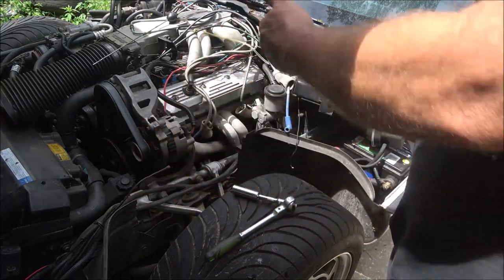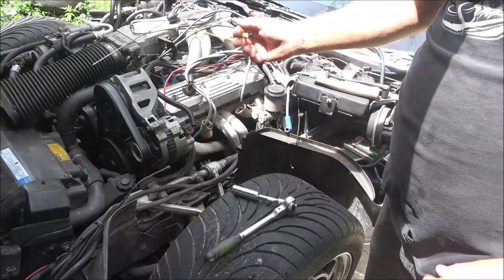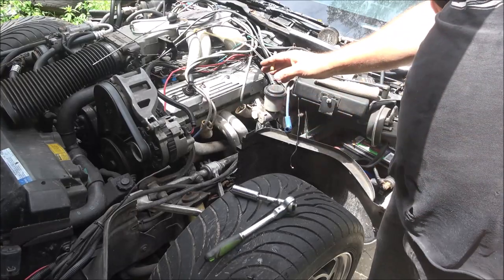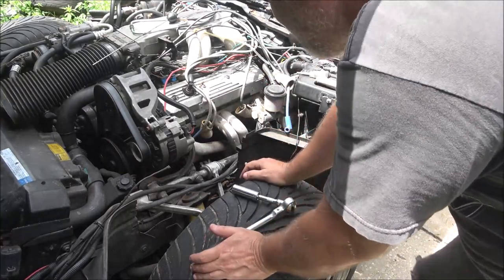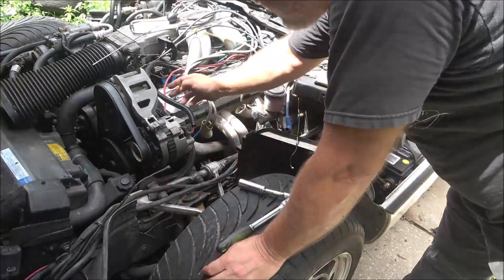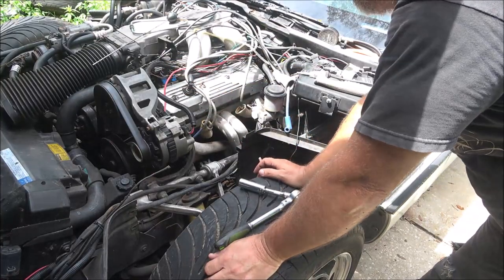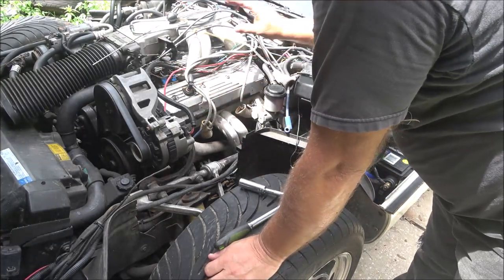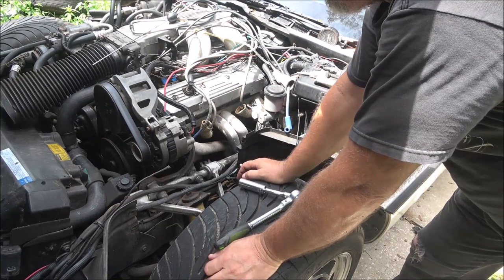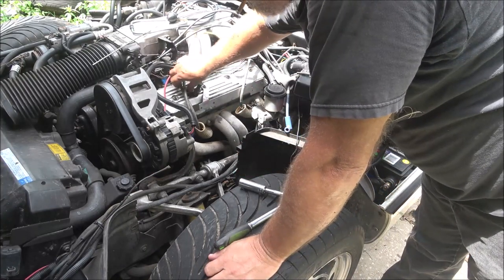And then you're guessing on how much you need to adjust the rocker arms, adjust your valves. And you do that with the rocker arms. But I'm going to go ahead, if I remember right, and I know I got to take one of these bolts out here, because I can see it coming through. It stops it from coming up out. I got to take off the alternator wire. And then these up here, it's pretty easy. I'm going to pull the plug wires off, move them out of the way. And we'll just go from there. And we'll see if there's a problem up here on top.